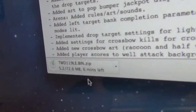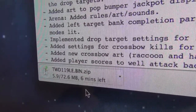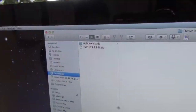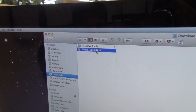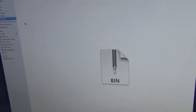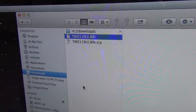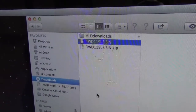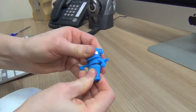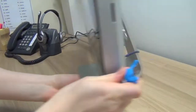At the bottom you can see the code downloading. We've got a very slow internet connection so it's going to take a bit of time. Here's the file: twd119le.bin.zip. You need to extract it by double-clicking on a Mac, or download a zip extractor if you're on a PC and don't already have one. This will give you the extracted .bin file. Then plug in your USB stick — it's best to ensure there's nothing on it at all, and maybe even reformat it to be sure.